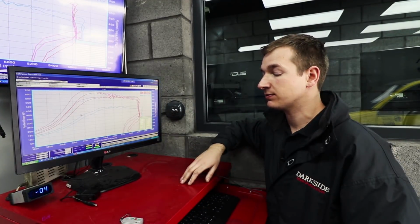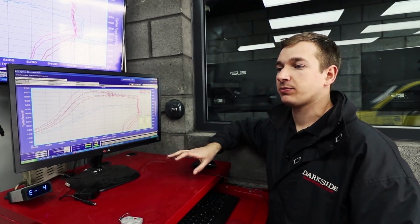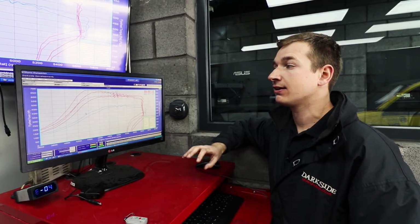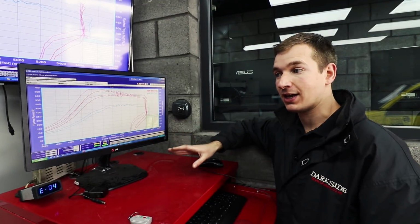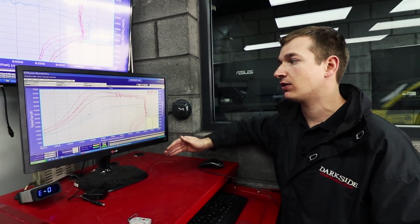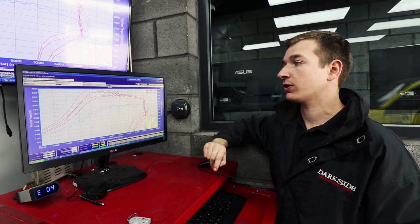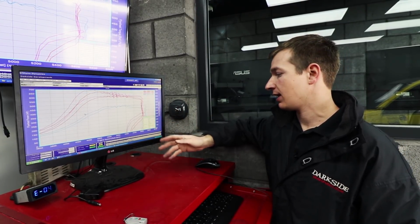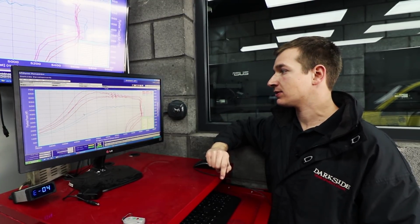Obviously, we can't be too sure. But we know from our experience, even using the pulsoids, which are the best solenoid-based nitrous system, we still had problems with the engines, not caused directly by the pulsoid, but the sort of issue you get pulsing the nitrous is what will kill the engines. Whereas the Revo system, there's no pulsing going on. It just works a treat. So it was worth all the effort that we're going to.